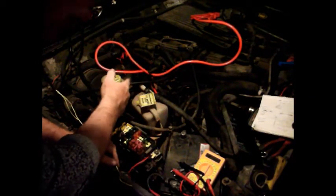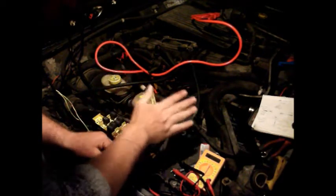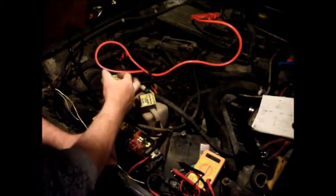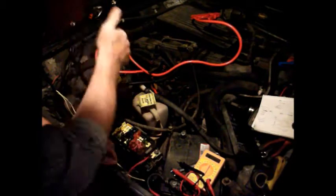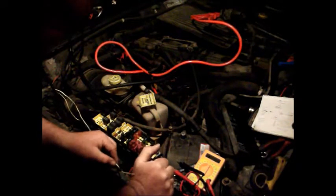Now we've already shown I can jump the starter motor off the solenoid pin, so that's really just a case of getting a live to that, so I can take a live to a starter button through another relay, and that will give me starting and fuel. So with any luck then it should start.